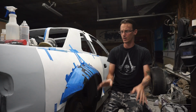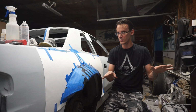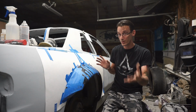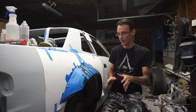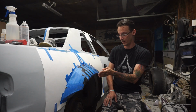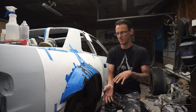Make this a little bit quicker. I filled these in. That's not structural. That will not hold. The reason I did that is it'll hold good enough for me to get the panel off the car. Make sure it's straight, make sure it doesn't move. Make sure it's reinforced really good. Hopefully I didn't miss any of the little finger thingies. Now they're not perfect, but they couldn't have been perfect to get the new angle of the wheel well. Because S13, S14 wheel well seems to be different.